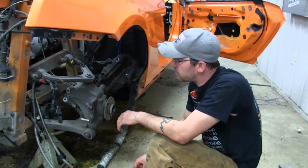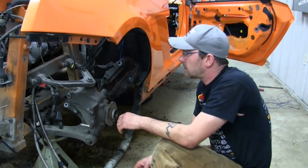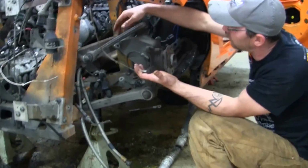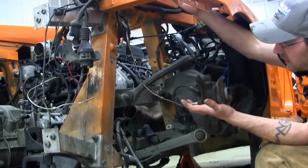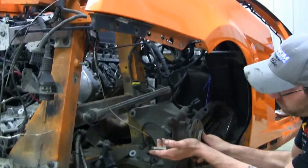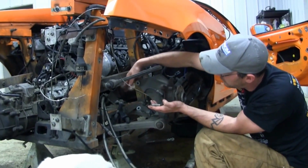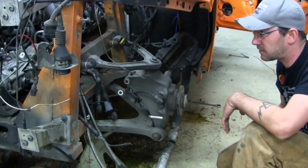Okay, now one picture you showed us, when it was up all the way and it had the axle in there, it looked like it was going to hit that top bar there. Can you point at that? Up in here, when you go up with this, right? If you were to ever compress your suspension that much, the shock will limit your upward travel there. If you were to go this high, your tire would be sticking out the top side. So somewhere right about in here is where you'd eventually run out of usable travel due to wheel clearance issues. Gotcha. So we'll have something else limited by the time it gets to that. Yeah, at least in the rear, there's definitely no issues with CV axle clearance.